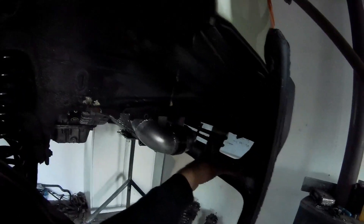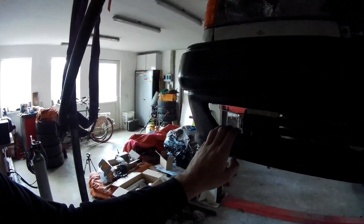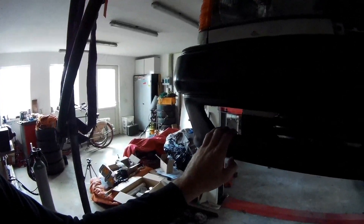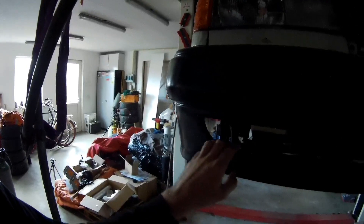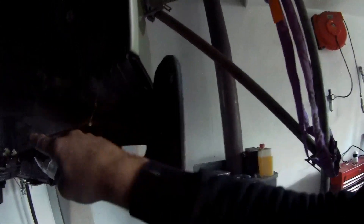There will be a cooler over here. My plan is to do something with these lights — these are the fog lights for the 500E, normally an SL R129 fog light fits in here. I don't have a button in the car for that so I'm not going to use them as fog light inserts. I'm going to put the coolers on each side — engine oil cooler on this side. The transmission cooler is on the other side, same as in other cars originally.